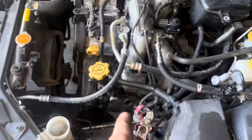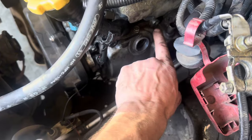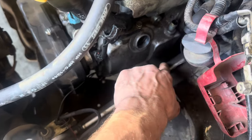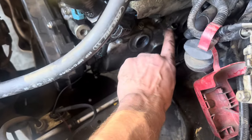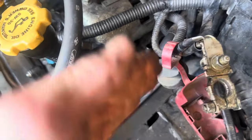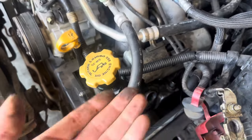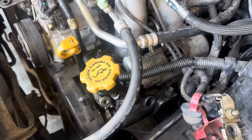For this video I'm going to be doing the driver's side. You need to pull off your 10 here, 10 down there, 10 here, 10 down there, 10 there, 10 there, and then pull this vacuum port off. Once those are all off you're just going to pull the valve cover out and up. If it doesn't fit that way you need to take the two motor mount nuts off, lift the motor up a little bit, and then take the valve cover off.